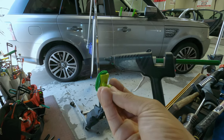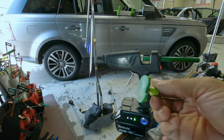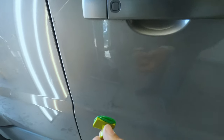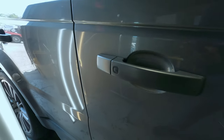Right now, the only tool that's working is the PDR Finesse 245 tool, which you see in the video. And that's because it's sharp and it's the only way to move metal right now. That metal is something else. Every manufacturer just has their own thickness, makeup of the metal properties, but this is just a tank. So it's just requiring so much effort.